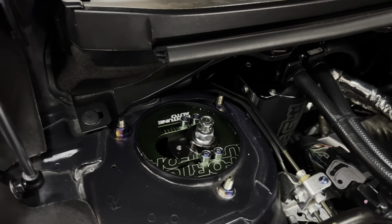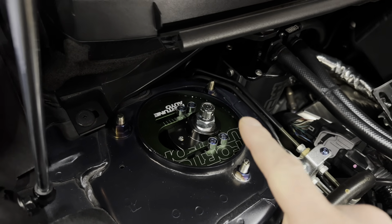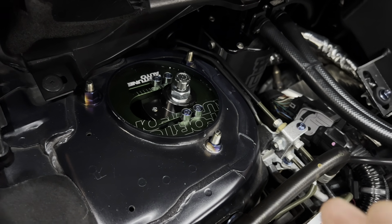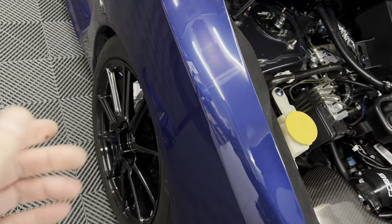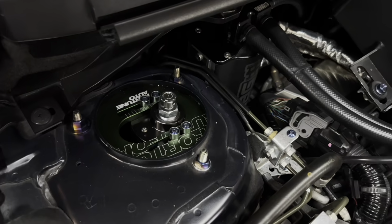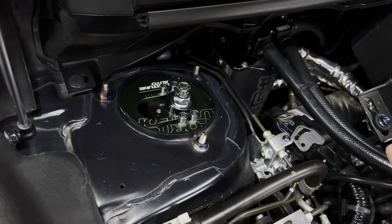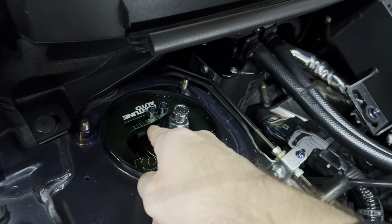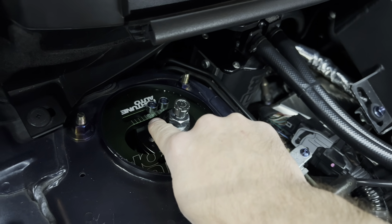I'll try to explain it before I do it, but you can see the notches on the back of the camber plate back here. Technically the dash with the circle around it is kind of dead center. But I'm also adding camber with the stock camber bolt on the strut as well, so it's not going to be exactly at 0. What I did on the other side, this is already pushed all the way in, so it's as much camber as possible, but I brought it all the way to the notch right before the circle. So 1, 2, 3, 4, 5. It's on the actual 5th notch.